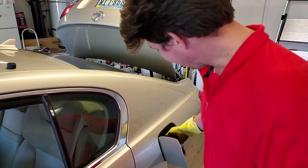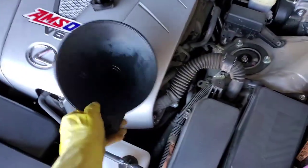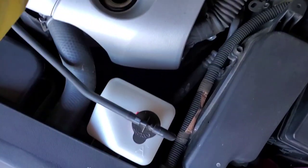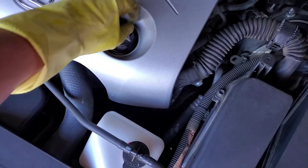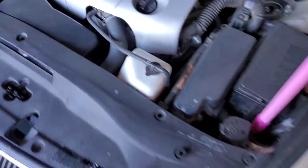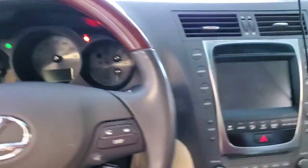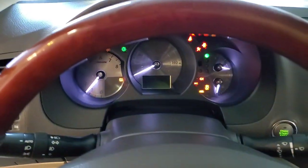That's all three. Now all we do is go ahead and motor her up. We're going to let her idle for 15 minutes, and then it's going to be time to drain her down. We still got a little smoke coming out because we got her so hot — we let her idle for about 20 minutes, which is really good. It's good to have a good hot motor when you do the flush; it helps loosen anything up that's in there. I've done about a hundred flushes on the channel and I've never had one problem.